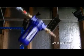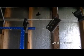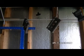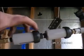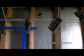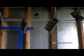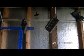I got this one here, and it comes right off the tank and works under pressure, relieving off the water. And just for extra precaution, I went out and got 2 more air separators, put them side by side, and they're in line, so they can work in conjunction with taking out the water as it goes to my siphon gun. So that's that. You can go pick them up. The inline ones are like $10 to $15 a piece, and the first one I showed you was like 20 to 25.